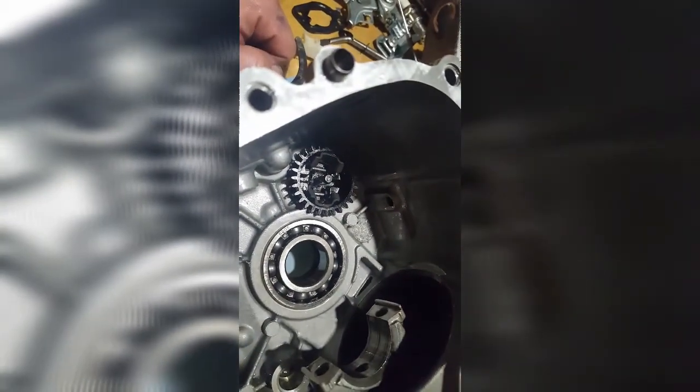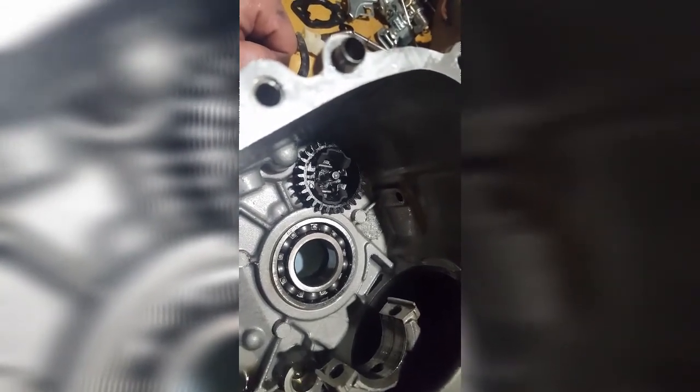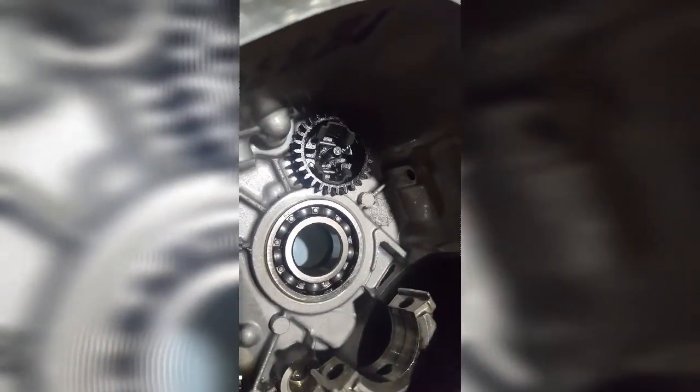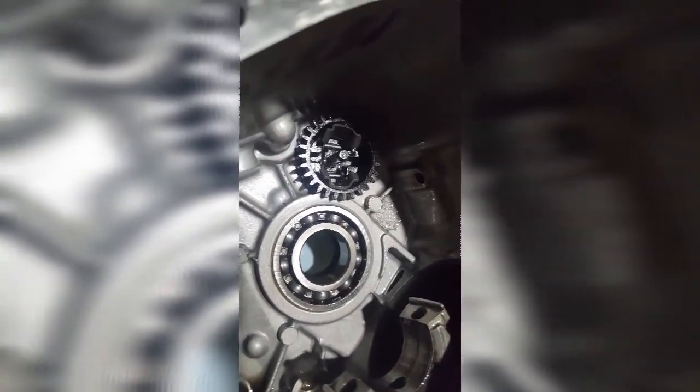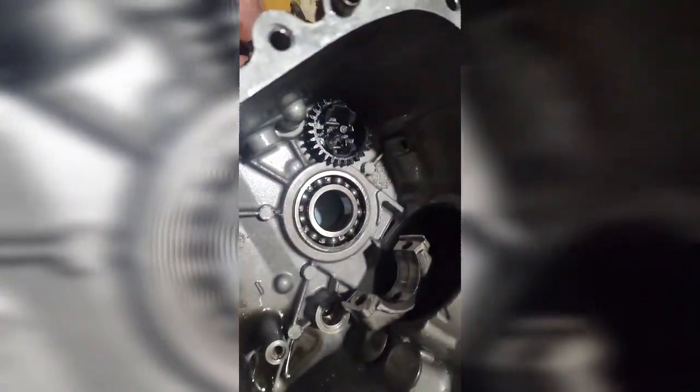See, governors are bad, but I'm going to take that out, and after I get that out, I got to tap it and put a 1/4-20 bolt in there, and the same thing with here on top. I've already took that part out. I got to tap that, do a 1/4-20, and then I still got to replace this connecting rod, and then it'd be all ready to go back together.